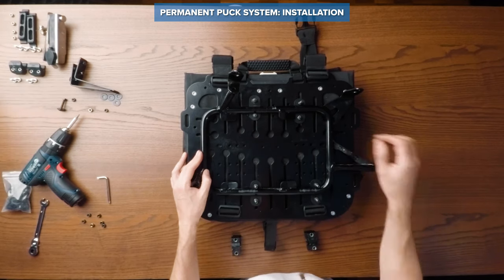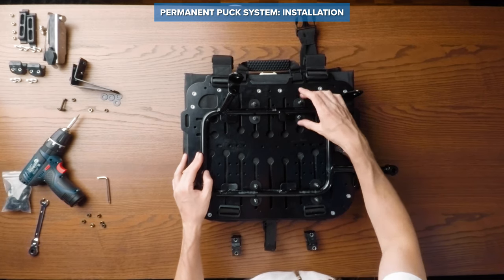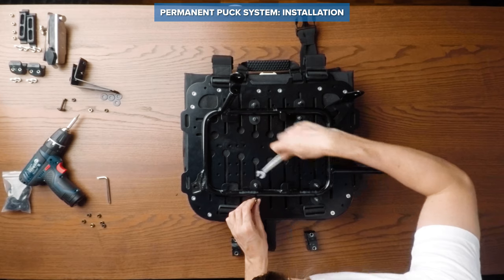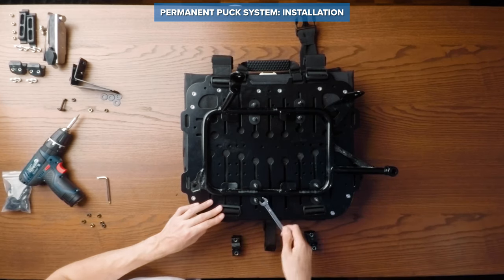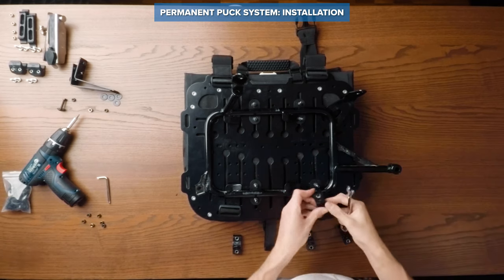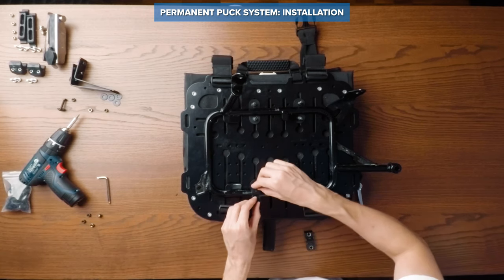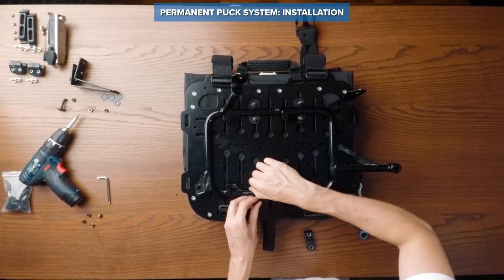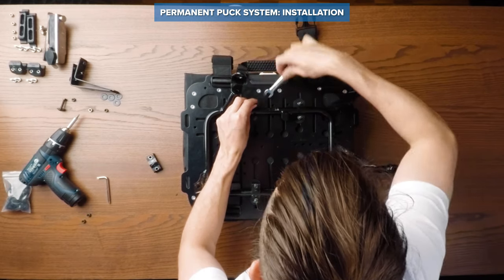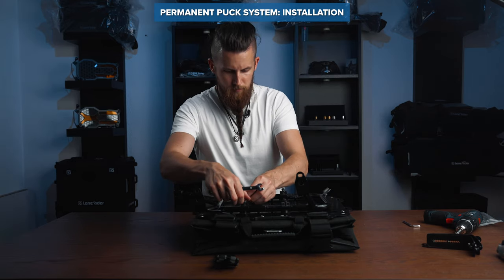When you're finished, check and adjust the position of the pucks to have an exact fit to your pannier rack. For the sake of this video, I have removed the rack from my bike so that you can easier see what I mean. Once the position of all four pucks is correct, tighten all nuts and install the motorbag to your pannier rack. Secure it with the C-shaped clamps using two lock nuts each.